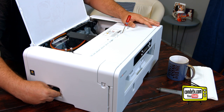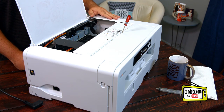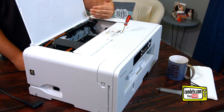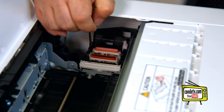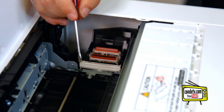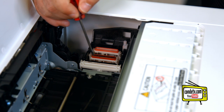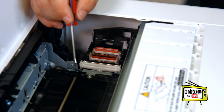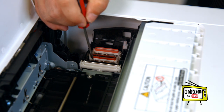It's going to slide over slowly and you want to get it to the right side. Don't let it get all the way to the right because it's going to slide back very quickly. What we're looking for is this small square area here. This is the capping station itself, which is a pump — it has small hoses attached to the back and uses wheels on the hoses to pull in suction like an IV. So if you have any clogs in there, it can cause quite a problem in your printing — it's kind of like having a stopped-up plumbing unit.